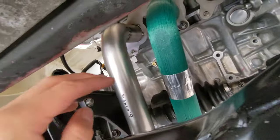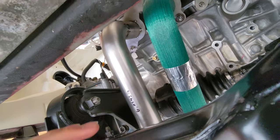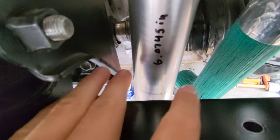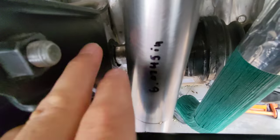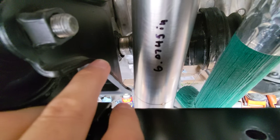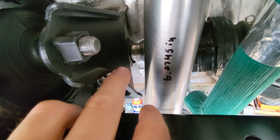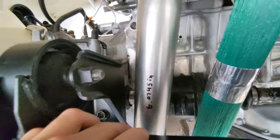I'm hoping the final design will be equal enough length to give me that sound and stuff. The clearance is actually pretty good. I had messed up this runner last night — I had clocked it a bit too far to the left and it was crashing into the mount. I probably could have just ground down the mount because that's not too big of an issue, but whatever — made it fit.